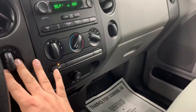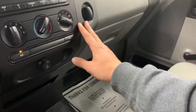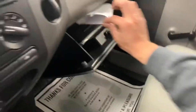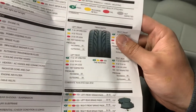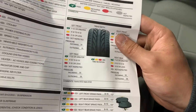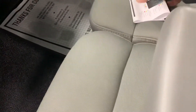Four-wheel drive selector over here. Your radio — pretty standard stuff: AM, FM radio, CD slot, and air conditioning. Taking a look inside the console, you'll find not only the books but also the results of the multi-point inspection we performed in our shop and anything we did while it was here. We did give it an oil change. The front tires are 8/32nds and the rears are 9/32nds — about three-quarters of the original depth. We also put all new pads and rotors all the way around the truck, so your wearable parts are taken care of for the foreseeable future.